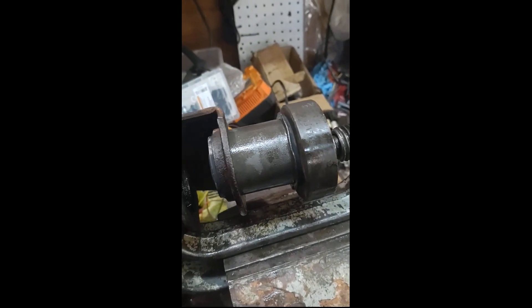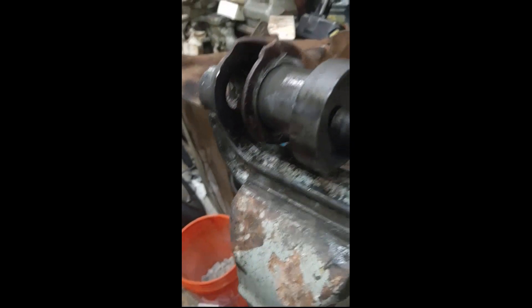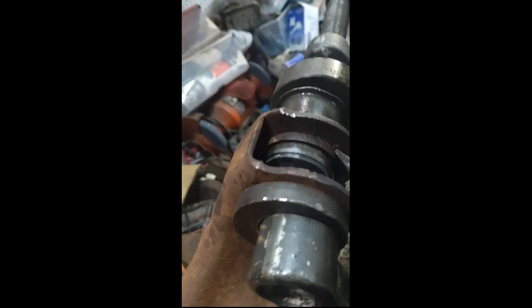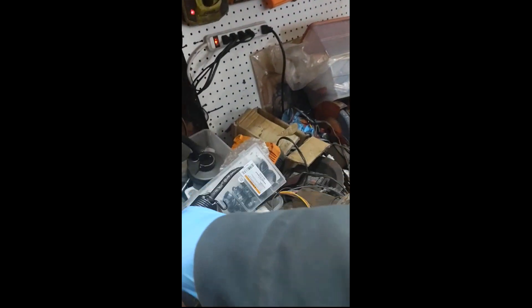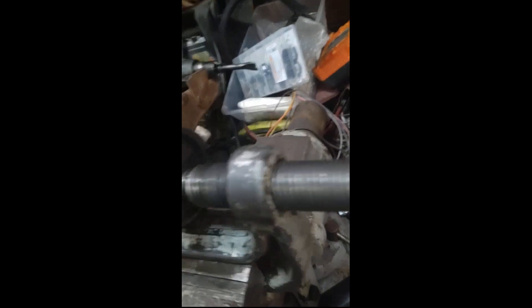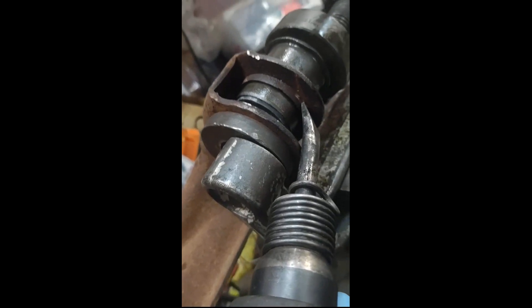I got a new bushing and started whacking it in - it started bending. Now I have it loaded up with the air gun and swept the air hose to it. See how it just jumps right in - that's pretty much how you do it. You can see the whole thing flexed, not really bent. I can probably go a little harder on this as well. The whole thing actually moves and recenters itself. It doesn't help that this isn't on target, but you get the idea - that's how you get it in. I had a lot of hard time with these as I said, but hopefully it all goes in.